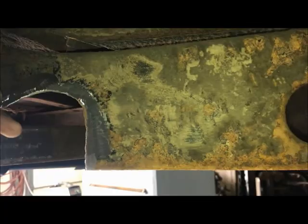All right, continuing on the truck arm suspension, now that the front cross member is welded in. I've been thinking about this. I think I'm just gonna cut these rear X's right out of here because it's really not doing much anymore, I don't think, with the relief cuts needed to get to the bolts on the arms. What I think I'm gonna do is just cut these out, cut them straight up from the cross member, and actually box the frame rails on the rear section.